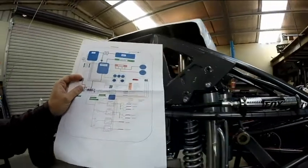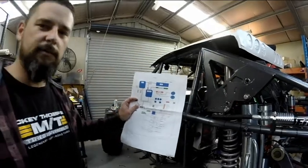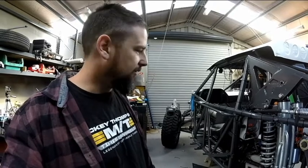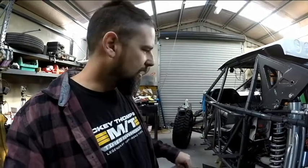Now look, it wasn't a major thing to rewire and change, but it was a little bit disappointing because they're not cheap, and it really wouldn't be that difficult for Racepak to implement. Even if they had limited channels that you could do that, it would literally be for them probably an extra one or two switches that you could turn on and say, well, these ones aren't just bus fed, they can be either 12 volt bus fed or ground fed. So then it gives you a lot more opportunities to do things. But so, trap for the newbies.